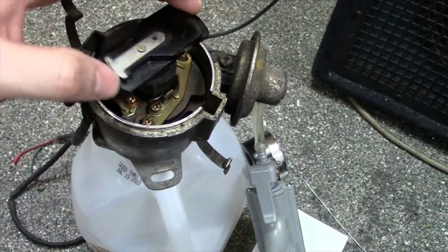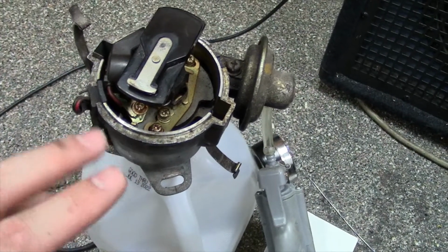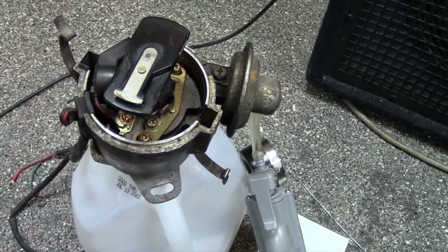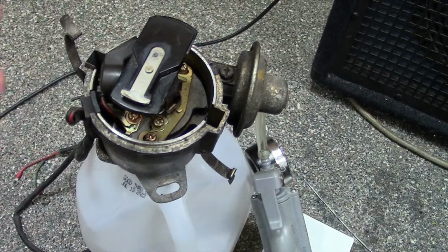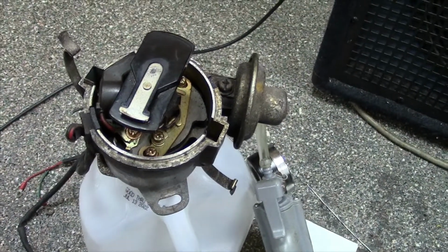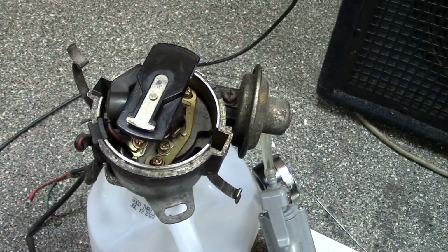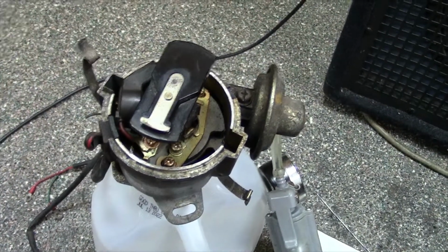Now, something to note too, going back to a '76 model Datsun that's a non-California model. In '76 you had a California model and a non-California model. The non-California model, which is what I've got, doesn't have the EGR valves or the catalytic converter. The only bit of emissions it really has is the evaporator tank, the charcoal canister. And of course I've got problems with my charcoal canister, which you'll see in the video where I'm showing the car. I've got it disconnected, because I was having vacuum advance problems: the charcoal canister has internal leaks in the valve associated with turning the charcoal evaporator system on and off. So it was causing a vacuum leak inside my setup, which you'll see.